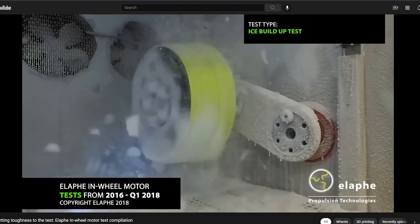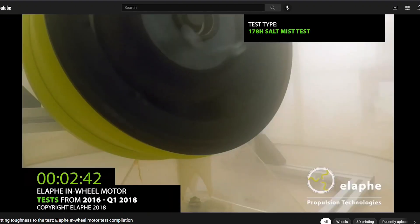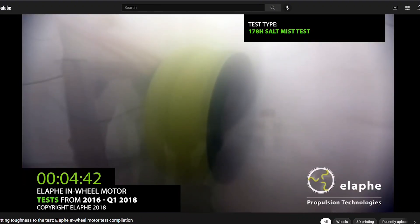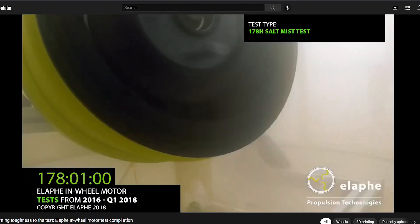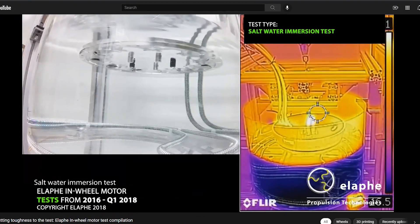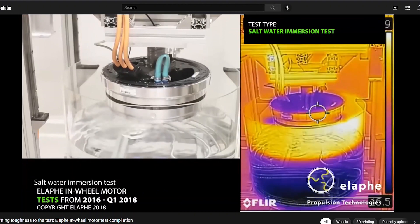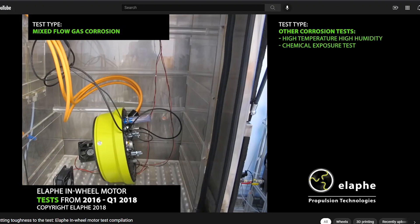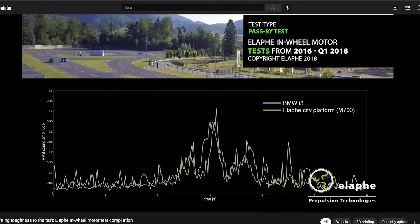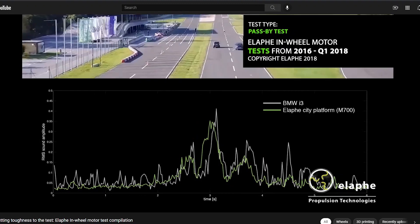They had it completely iced up, and it has so much torque that it can just rip the ice right off. That's another advantage: high torque, and it allows torque vectoring, which improves handling. Also, you can monitor each wheel with millisecond frequency, enabling safety features that are not possible with any other kind of drivetrain. If you want to listen to the entire webinar by the chief engineer of Protean Electric — he talks about all those things and it's very interesting — I'll put that link in the description below.